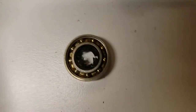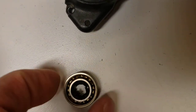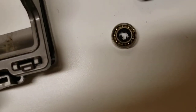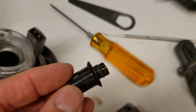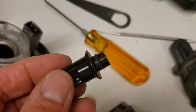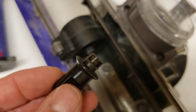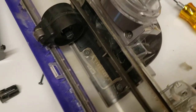There's melted plastic inside. One side of the dust cap has completely come off, the bearings are exposed, and the hair is getting pulled into the bearings. The bearing starts having friction, it doesn't rotate easily, and then it begins to spin on the actual motor cog. You can see on this one it literally melted off the motor — that small part protruding is supposed to be part of the cog inside the housing, driven by the belt from the motor, and it has just melted off from the heat generated by the friction.